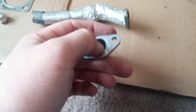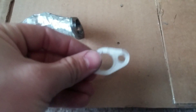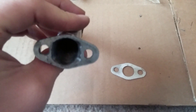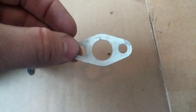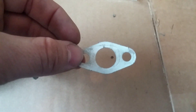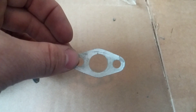Something else you want to do is make sure your gaskets are cut out to match, because if you don't, then you're still going to be going through this little dinky hole. This is a stock gasket, and if you're not matching that, then you're just creating a barrier anyway. You can see where it was crinkled up against the stock jug — it's got quite a bit of an indent in it, and that's just wasted space. You've got the oval intake on the jug itself and you're just constricting it by putting that gasket in there if you're going to port it out to match it up.